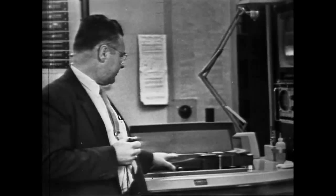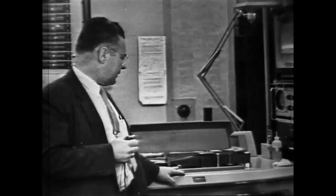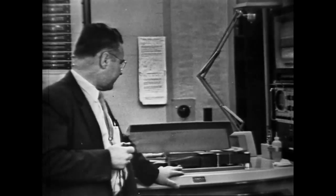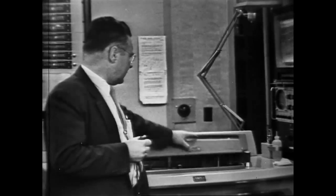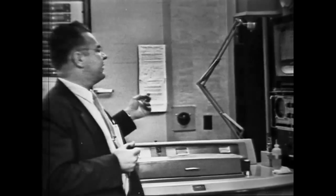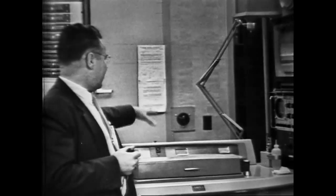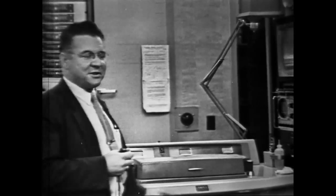A buildup of oxide on the audio head or video head can cause a serious interruption of program material. Therefore, it is our policy to clean all parts of the machine — including the capstan, the heads, and the drives — each time the machine is put into operation, whether it be for record or playback. These lights that you see are not used in their normal condition at the present time. They're normally turned down over the machines for operating. We need a little light in here to do this pickup, so we put some big bulbs in them and pointed them at the ceiling.